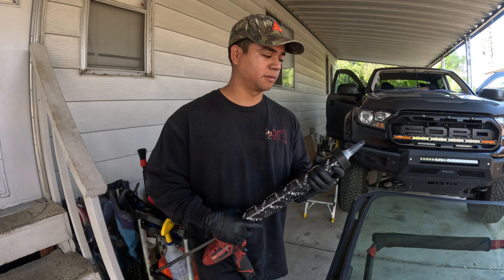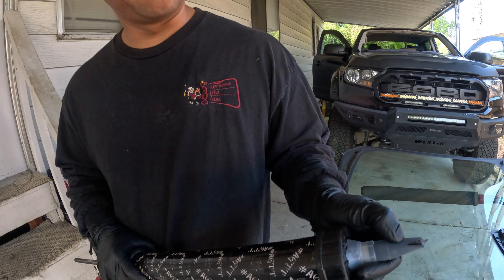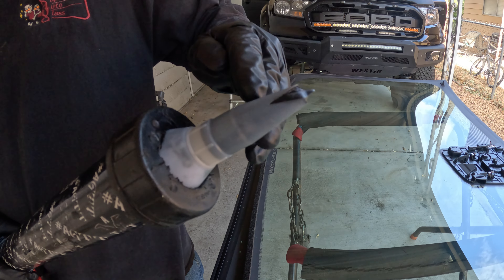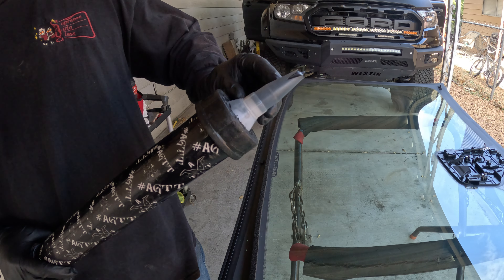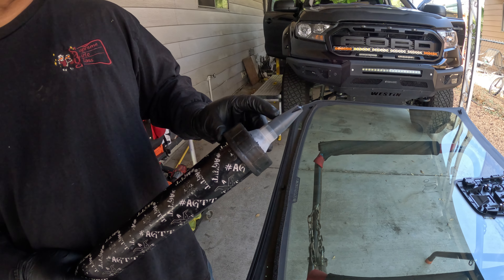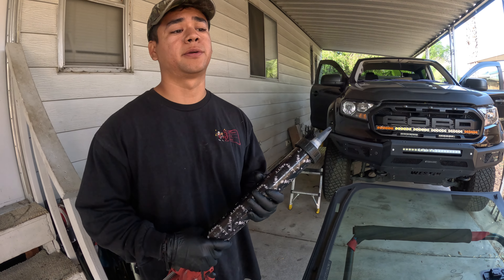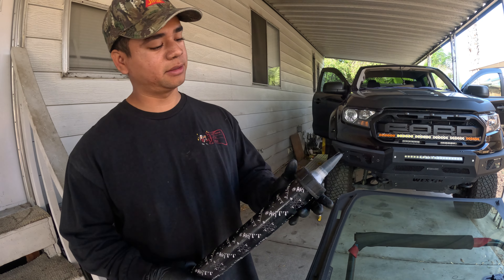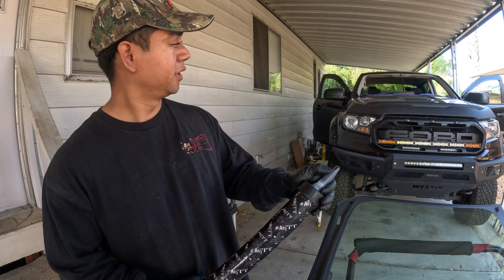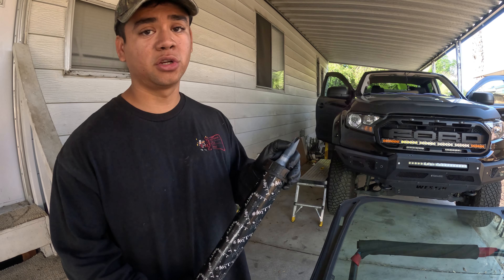The only thing I will highly, highly recommend is that you use a V-bead. There are some places that just cut the top off evenly and use like an O. The problem with the O is that a lot of air gets stuck in between or inside of the glue and it makes pockets of air. So to avoid that, the V-bead is just superior. Doesn't matter if you shoot it on the glass or the body — just make sure you have a V-bead.